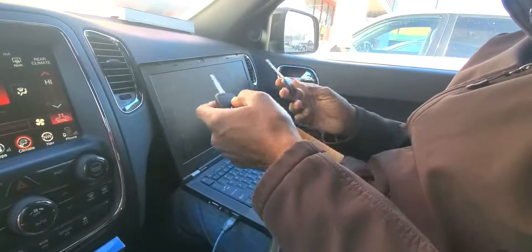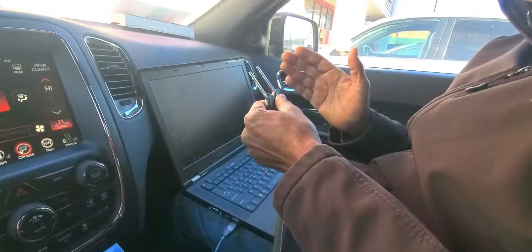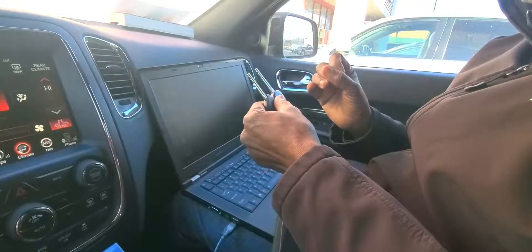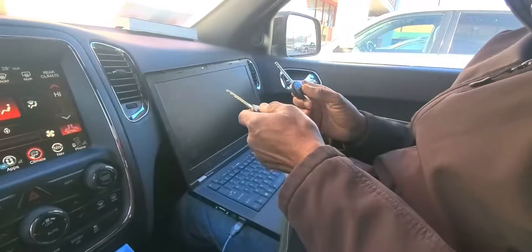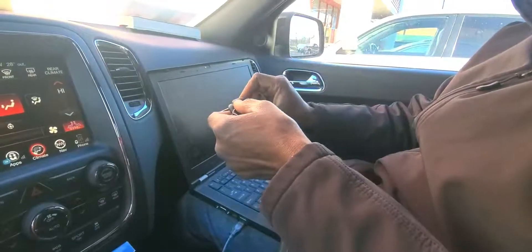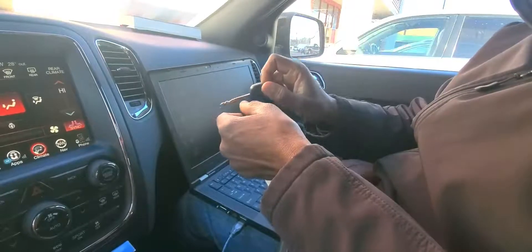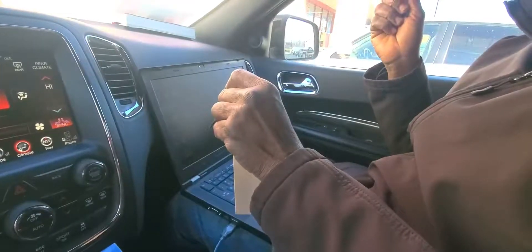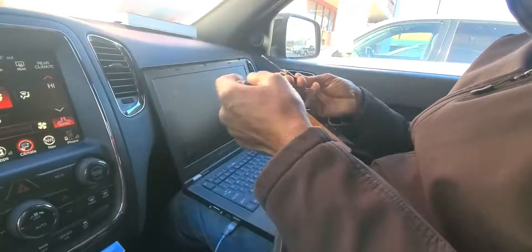For 2003 to 2005 Toyota Highlander and some older Toyota Camry models with a 4C chip, you must program manually. Put the key in the ignition but do not turn it on. Push the gas pedal five times, then push the brake pedal six times. Take the key out, put the new key in, push the gas pedal one time, and the security light will start blinking repeatedly and then go off — meaning it's registered.